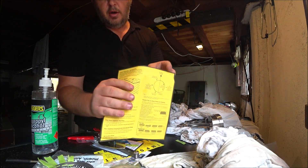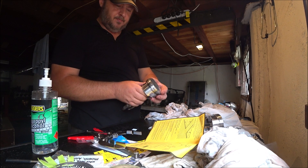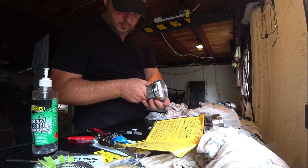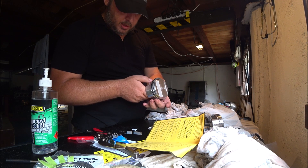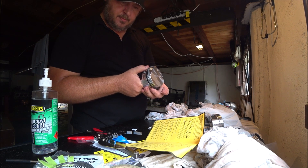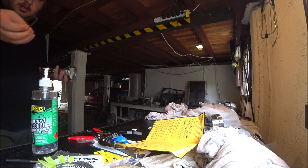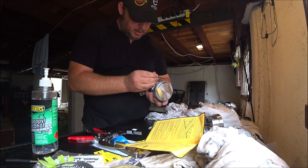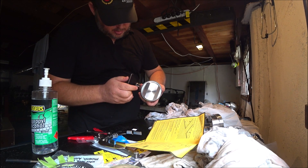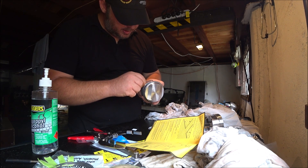There's an orientation that comes with the rings. Bottom oil ring gap — front of engine is the spool logo. So the bottom oil ring gap goes there. The oil ring expander gap range — there's a small hook. I should be able to just drag this around. It's taking the whole ring assembly with it. Just drag that around until I find the gap — this is fiddlier than I expected. Try and hold the bottom oil ring in place while dragging the scraper around — there we go.